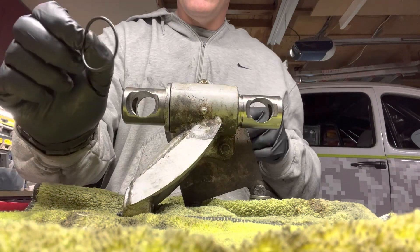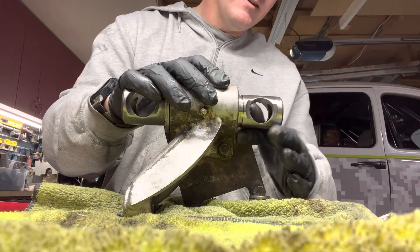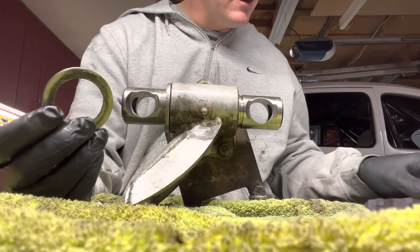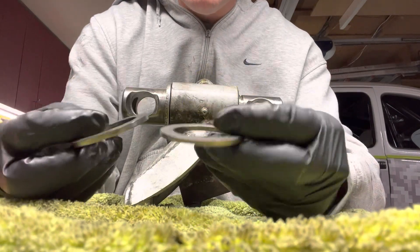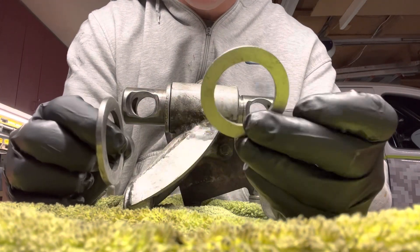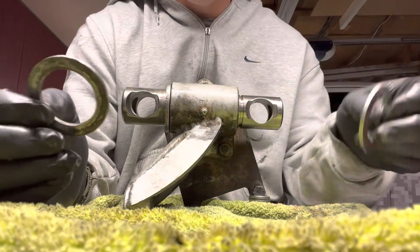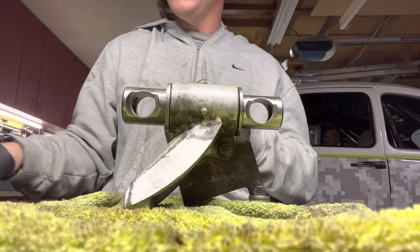Put the kingpin into the spindle, then take the Tweed O-ring and put it down in there — that's going to seal out any water that gets into the bearing. Then take your Tweed washer. You can tell it's the Tweed washer because it's a little shinier than the Fodral ones. The Tweed washer is a little thicker — about 3.6 millimeters versus the Fodral's 3.1 millimeters — so it brings the tolerances in a little more. Put this on the other side.